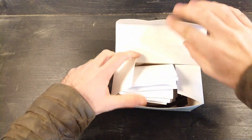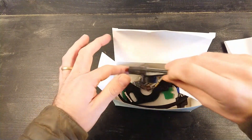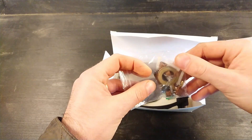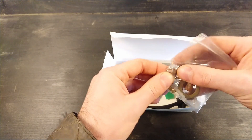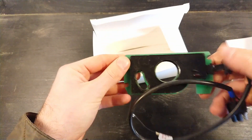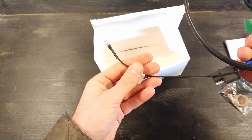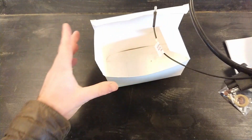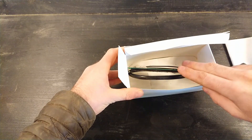So here's what you get in the kit. You get some instructions — put those to the side. You get a new rotor arm; your old one will not work with the new board. You get some new nylon screws, some washers, some electrical connectors, and some new rubber distance pieces. And at the bottom, the new trigger board itself. It looks pretty much the same as the old one, except you can't see the reed switches, and there's an extra cable that you need to connect up to 12 volts — I'll show you how to do that later.